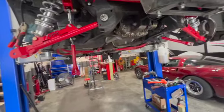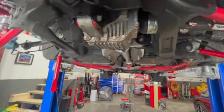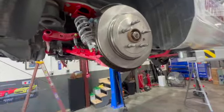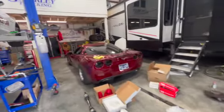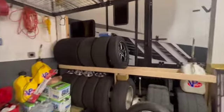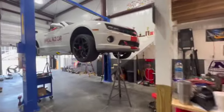And we get to put the exhaust back on it and get it all cinched down, ready to go. I could go ahead and actually put the exhaust on now, because technically the exhaust comes through here. So yeah, beautiful, man. I can do the exhaust by myself. I need help hanging the hub and getting those bars lined up. So yep, all that just to go with a smaller rotor to run a 15-inch tire and wheel. It's supposed to hook up better than the 17s. The 17s are here. So that's the 17-inch drag pack right there. So I don't know. We shall see there, Roger. All right, back to work.